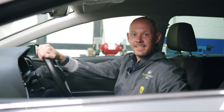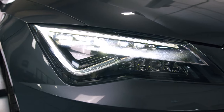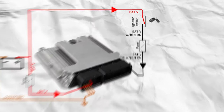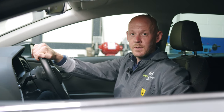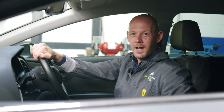At this point, the ECU is still in standby mode and not fully powered up. The next stage in its power-up sequence is when the ignition switch is turned to the on position. This action provides another fused positive feed matching the battery voltage to the ECU — sometimes through a separate ignition relay, but the theory is the same. Once again, this voltage can be measured directly at the ECU and should only be present with the ignition key in the on position. The voltage reading should be the same as your battery voltage. If the voltage isn't present or isn't the same as the battery, check the fuse first and then the relevant wiring for issues.